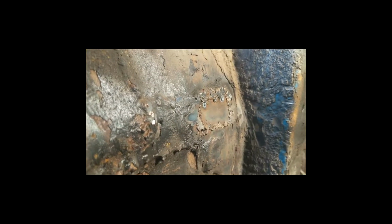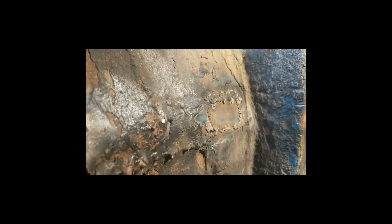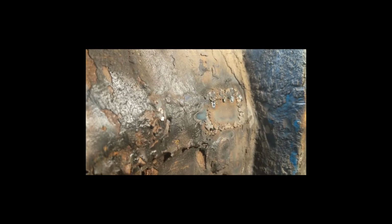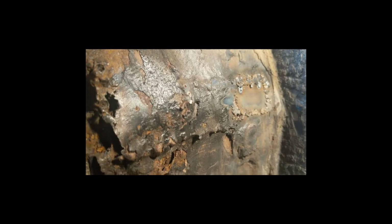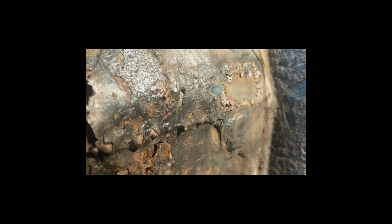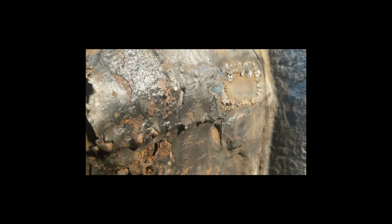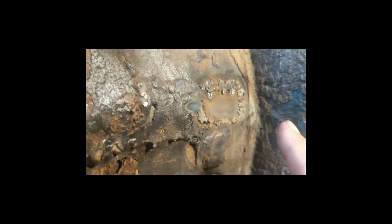And there we have it welded in place. It's just gone 11, so I've been out here just over 2 hours to do that little bit. Having said that, I did refit a couple of bits because I'd painted the back, zinc primered it, to even protect it on the inside. Having looked at it from the inside, I've got no light coming through, which is why it's a bit bulked up there, because I had a few across the top of it, across here.